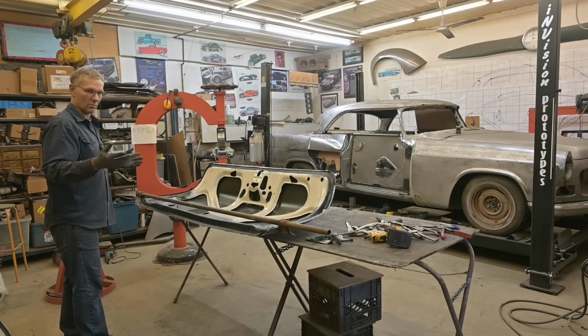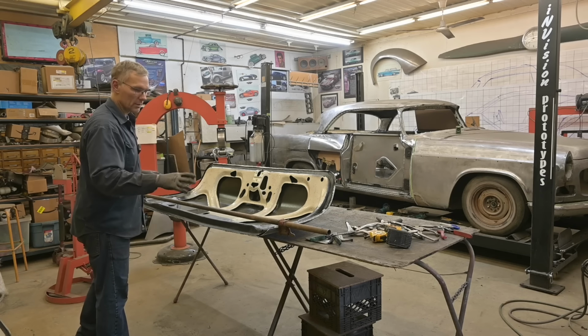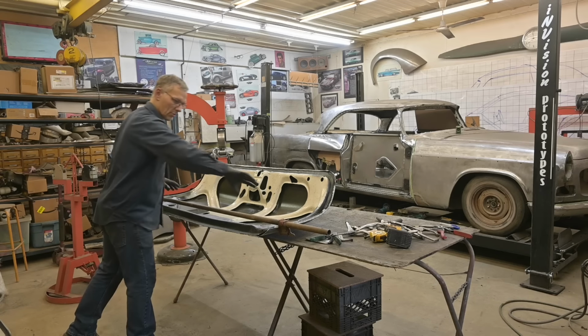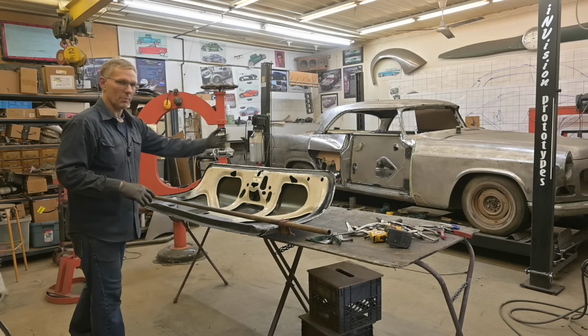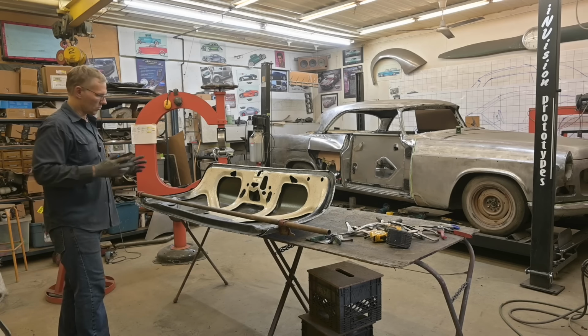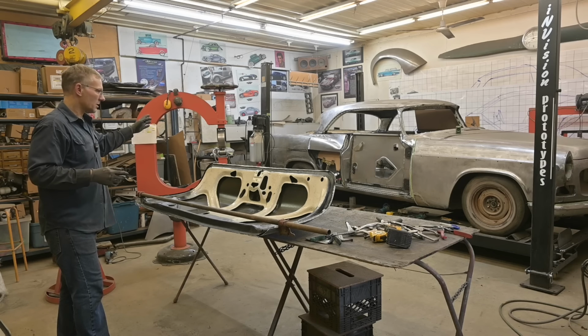It's been a little while. I've got the wedges installed, welded, metal finished. There's no way to get into those areas once this structure is in place. So that's done. I've adjusted the top edge and bottom edge of the trunk lid so that it flows with the bottom of the trunk area where the latch goes. And I've also adjusted that panel.